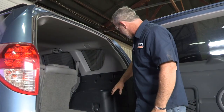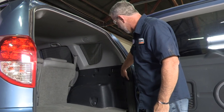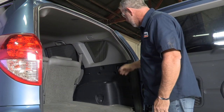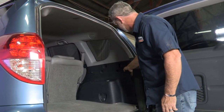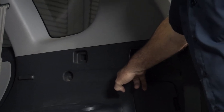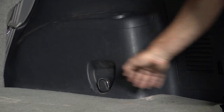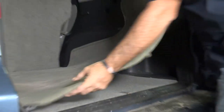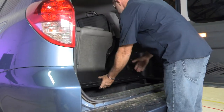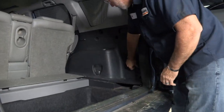Let's go ahead and prep the vehicle. To access our connectors, we'll have to take the paneling and pull it away from the body on both sides. To do that, we're going to use a Phillips screwdriver to remove here, a Phillips screw to remove here, a 10 millimeter bolt here, and a 14 millimeter bolt behind the cargo loop. We'll start by removing the flooring and taking those bolts and screws out. We also have some cargo doors here that we're going to remove.